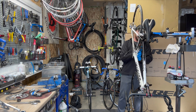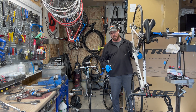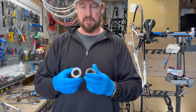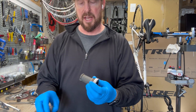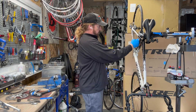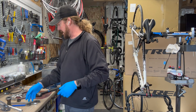Sometimes these get really tight. I'm just fortunate on this one. One cup will have an R on it and one will have an L, so you'll know right and left. The bearings have a little protective sleeve — that just prevents contaminants from the seat tube or water from getting into the spindle. It protects the spindle. That's the bottom bracket removal.